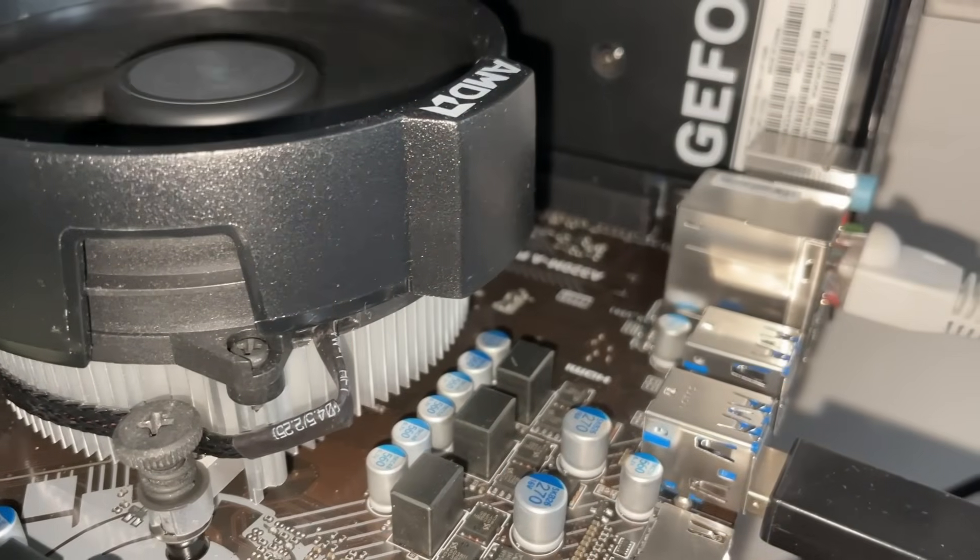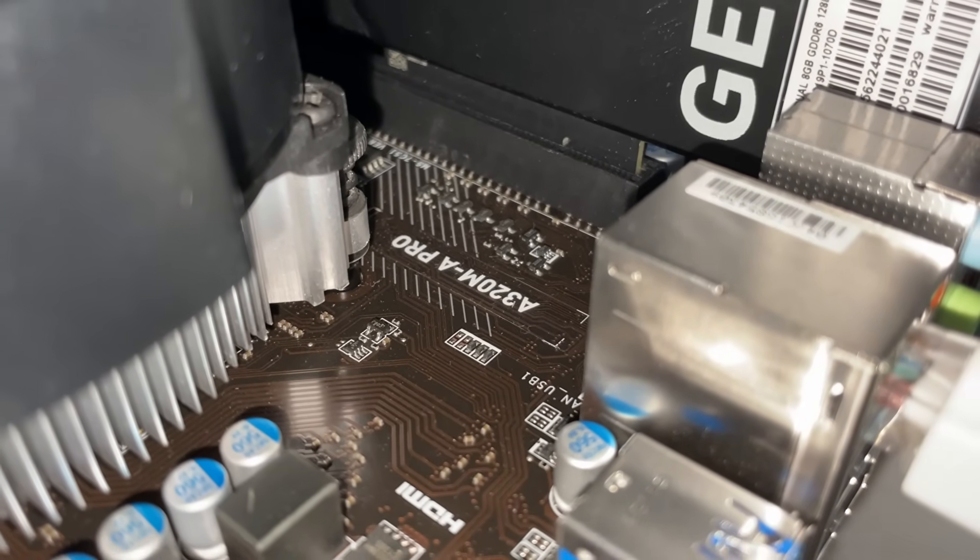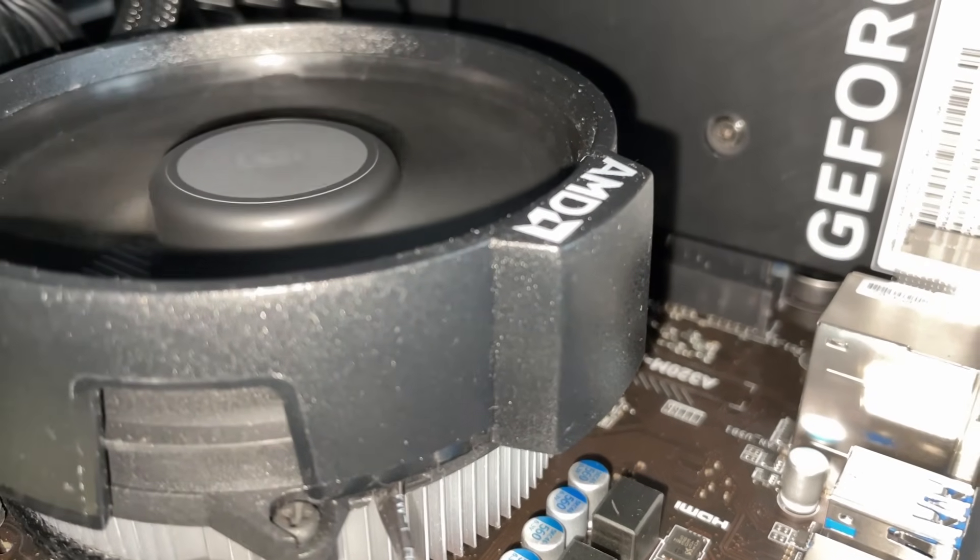To be honest I expected a lot worse from two cores and two threads. General browsing and watching YouTube videos isn't the most pain-free experience but it does work. I plugged this into an MSI A320M A Pro motherboard with 16GB of 2400MHz RAM — the fastest I could get working with this thing — and to be honest I've used worse. What I will say is that eBay originally sold this with a B450 board as a cheap CPU and motherboard combination, and the chip didn't actually work in that board. A few boards I tested — B450, A520 — were not compatible with the A6 9500E or the normal A6 9500 for that matter.